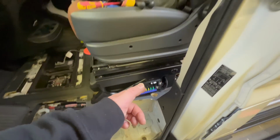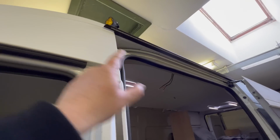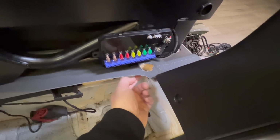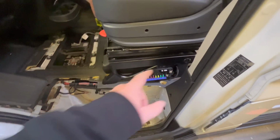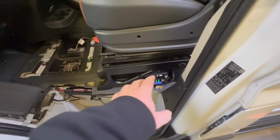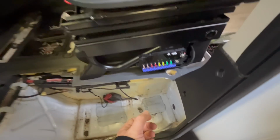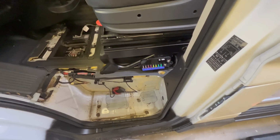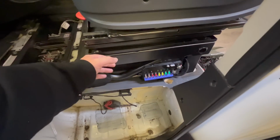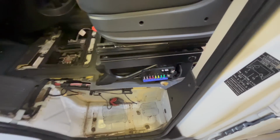And the roof lights that I've got up there, the cables up there, I can bring that down this pillar and bring it straight out under there and in through there. So I kind of hide it that way as well. So I think that's where the Aux Beam's going to sit. Plus it's easier then, if a fuse blows or I want to wire more things, all I've got to do is take this off, wire it in there, and it's done. I'm not going to be prissy about having a cover on the side of here or anything. So that's going to be a perfect location for it to sit.